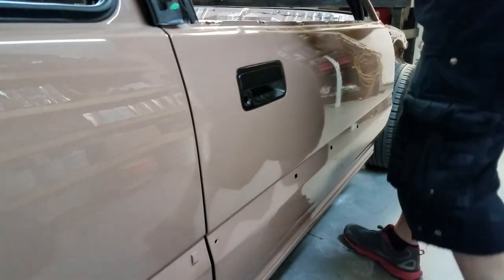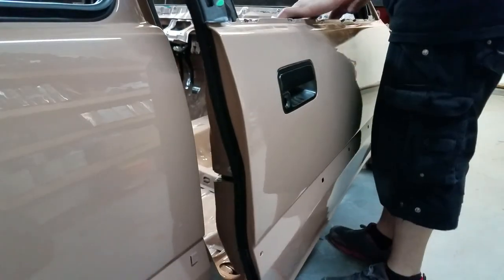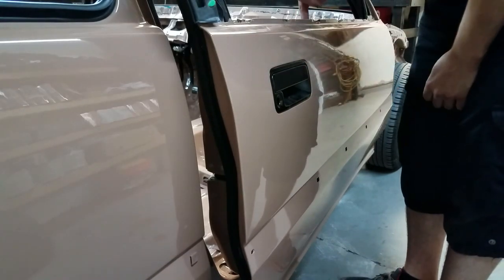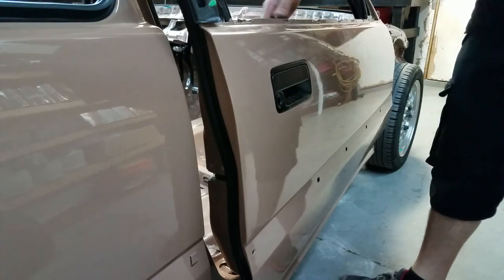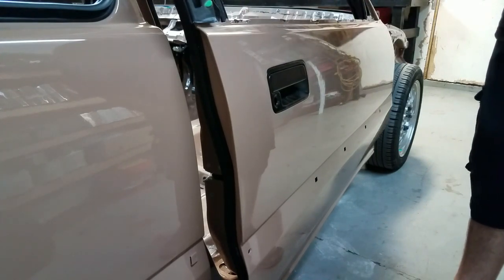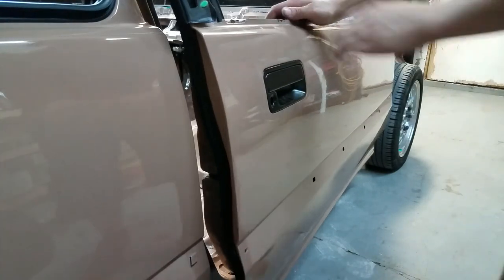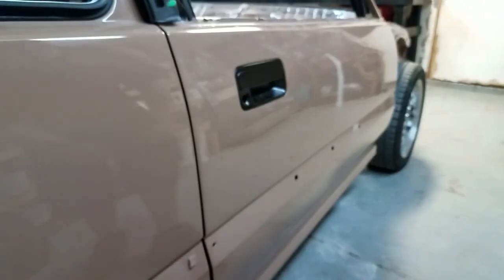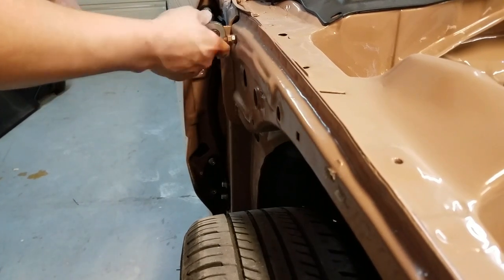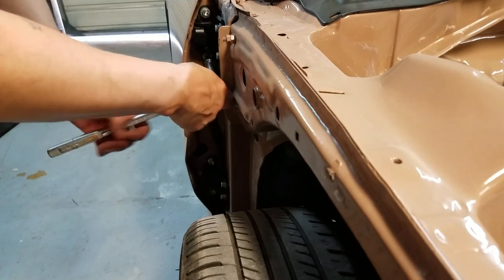It's all on there and it's working — check this out, how's that for some back pressure? The door needs to be adjusted a little bit. It's a little noisy — again, it's those little rods on the inside, whenever you shut the door they're clattering against the aluminum door panel. When I take this stuff off to paint it I'm going to put something in there where it's hitting the panel — like a piece of velcro with adhesive on the back — just to get rid of that noise. You have to really slam it right now, so loosening it relieves all that pressure. That's a lot better.